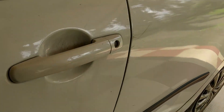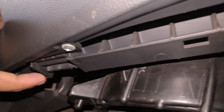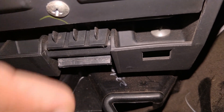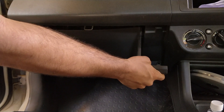Now let us replace the AC filter of this car. It is located under the front glove box of your car, so first we have to remove the glove box. It is very easy to remove because it is simply attached on hinge joints. All you have to do is open the glove box and pull it up from both sides like this.